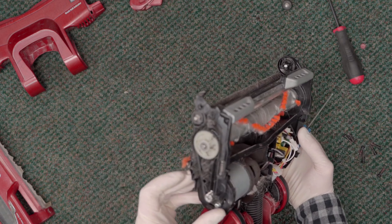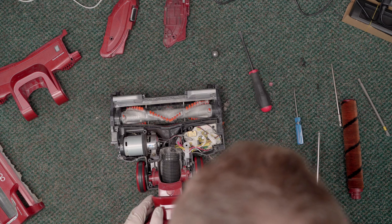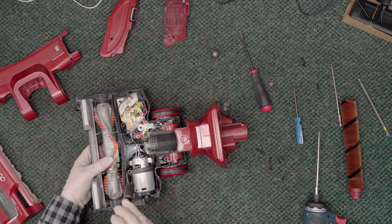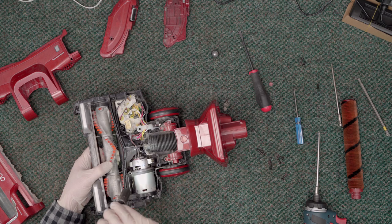All in all it looks like it should — I don't see any major issues. The brush roll feels free, no hair wrapping down in here. If there were, this vacuum would be toast. Now I'm going to take a quick peek at this motor — there's a fair bit of carbon dust here. And oh yeah — yeah, that's our problem. That's why it's turning off.